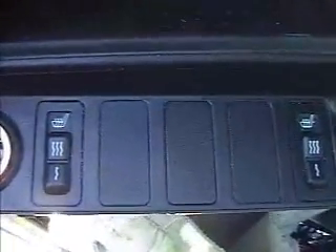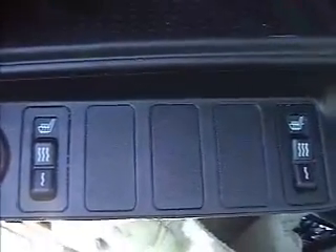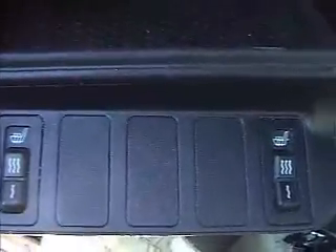I got my hole drilled so I can now start wiring everything up. I took the seat off and the side paneling. This is my positive wire — how my car runs stock. I'm going to start tracing all the wires through. I changed my design a little bit: I'm going to use all three switches — one to turn the cell on, one for the volt meter, one for the amp meter — and they go right in the middle, then up to the cluster pod.